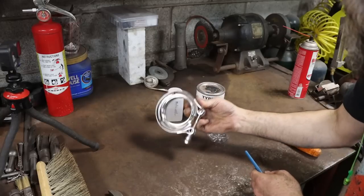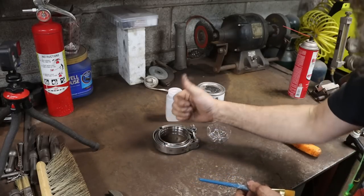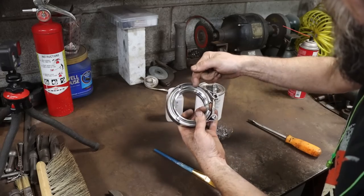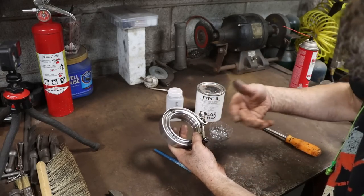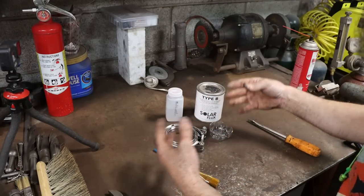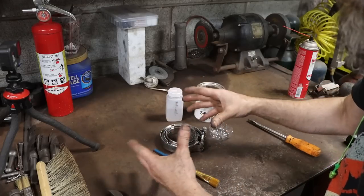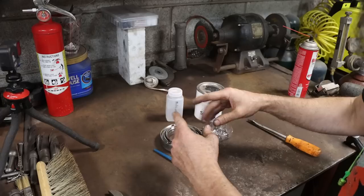Conversion joint. So I'm just about to weld these connectors, couplers, whatever you want to call them, they're stainless steel, onto my stainless steel headers, and what I don't want to happen is, on the other side of the pipe that I'm welding, the inside be exposed to oxygen and oxidize. Sugar is what I call it. Well, the way to combat that is to back gas whatever you're welding. Set up another gas system to purge the inside of the vessel or tube so it's an oxygen-free environment and you don't get that oxidation in there.